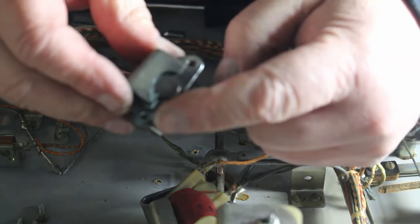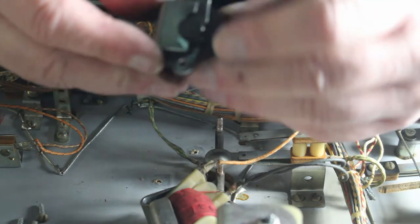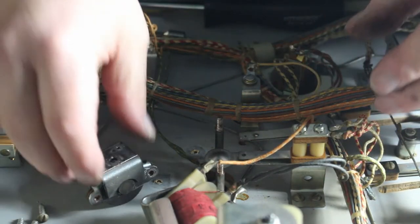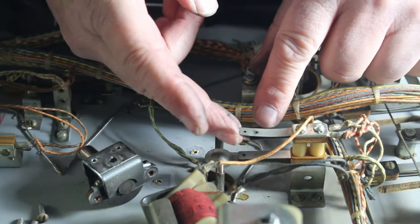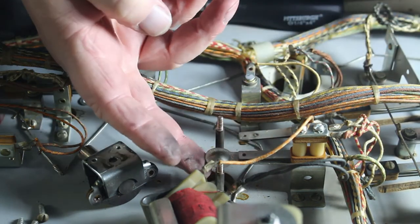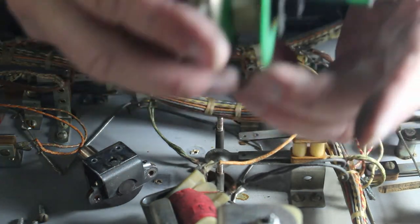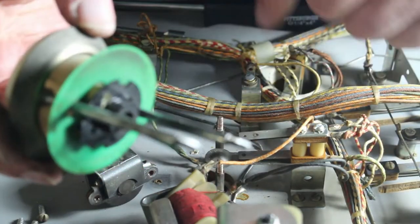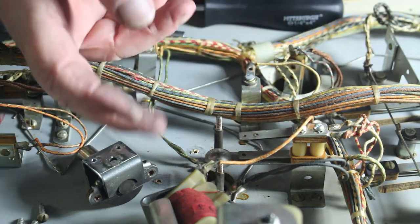This ring here is actually the end of the stroke switch. On these coils, on thumper bumpers, you have two switches, contact switches, whatever you want to call them. This one down here is the one that turns the coil on. That's this bottom green ring. That stud, that post that sticks down through, fits in this little cup here, and that's what turns the bumper on.